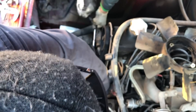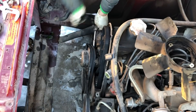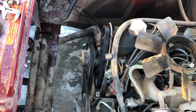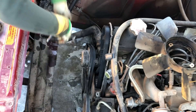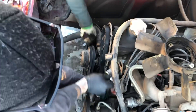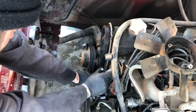Got to be careful with these alternators because they're always breaking mounts — you never want them too tight. My biggest issue is that I over-tighten them. If they're loose they'll squeak; just tighten them until they stop squeaking. Do you ever have an issue where the adjuster bolt broke? It's still troublesome. We'll just plop all these off. And a 24mm for the crank.